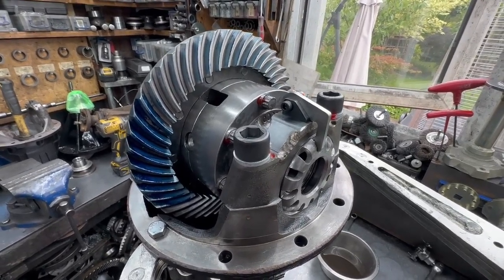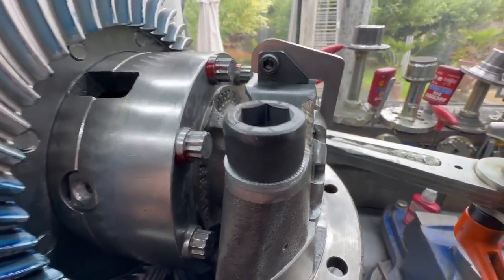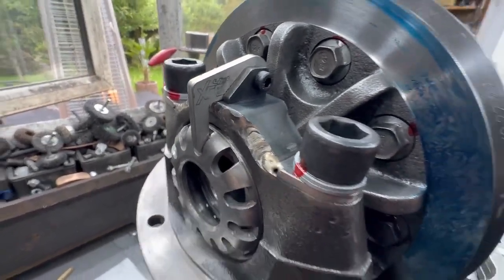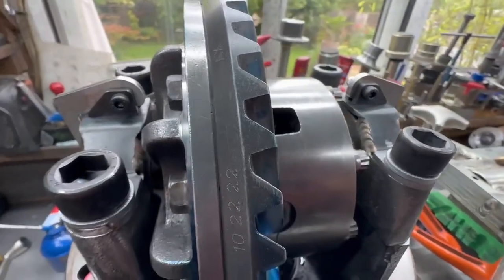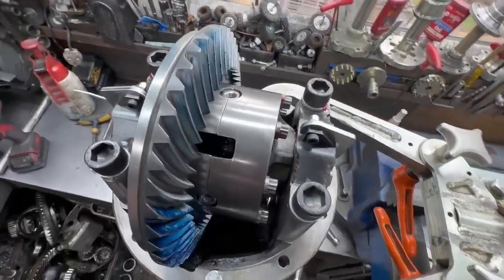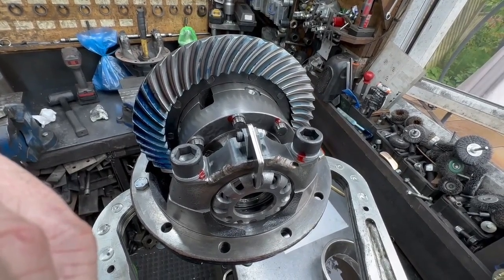Some considerable time later, we have a finished diff. This has got the final upgrades: our Domex carrier cap conversions, Nordlock washers with 12.9 grade bolts with Nordlock washers underneath, our own XS 4x4 ears made out of CS80 — tough as old boots. The Domex carrier caps get rid of the silly pin. The pad is beautifully marking on the back of the face, which keeps that big lump strengthening up the crown wheel. If you're really quick, this diff will be up for sale on the webshop. The video is really to show you what we can do to a short nosed diff to make it a hell of a lot stronger. Bye for now.